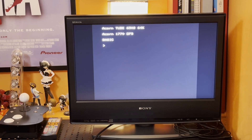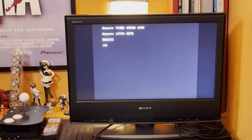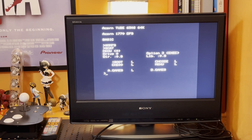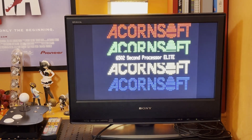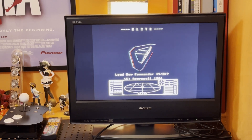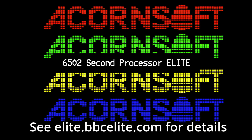Eventually I got to an active prompt line which would accept keyboard input. So now I could try and find the program which was the reason behind me getting this second processor in the first place. Issuing the star cat command didn't do anything, so I needed to hit shift-break again to get back to that command line. I then switched to the MMFS file system where the program I'm looking for resides, and inserted the virtual disk that had that program on it. Yes — the second processor version of Elite. Elite 3D, brought to us by the incredibly talented Mark Moxon. I've been after running this version of Elite on my master since I first heard about it.